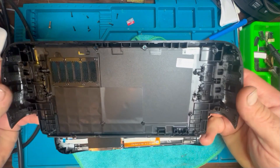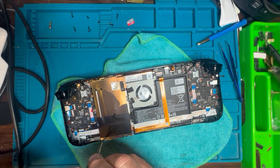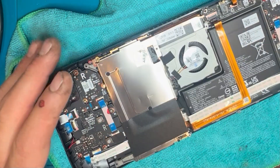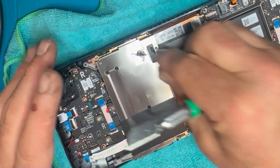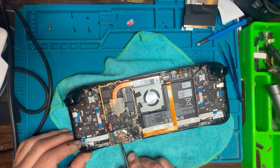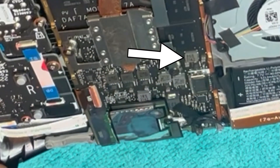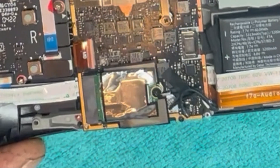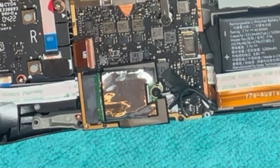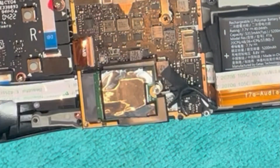We need to get the heat shield or RF shield off. There's only one hidden screw, and it's under a piece of aluminium tape — just peel that back and there's a screw underneath. Once that's out of the way it exposes the drive. Some people disconnect the battery; there's a battery terminal at the top right. I did a proper shutdown so I decided not to disconnect it.